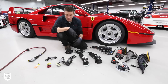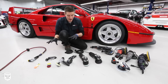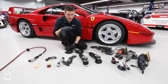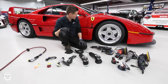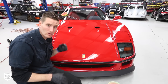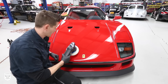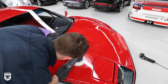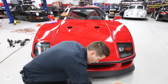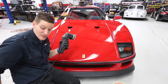Let's actually get started polishing. I've started polishing the paint and this is a perfect example of when I would change machines. I have my 21 with my pad - look, tons and tons of real estate, no problem. But would I be able to hit the air scoops? Clearly I wouldn't. So then I'd go with my microfiber coating pad and use the three inch to get in there.